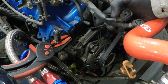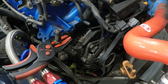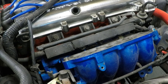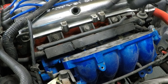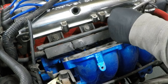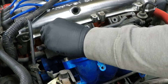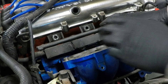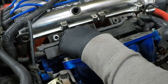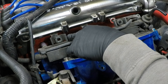Down the bottom here on the end of the wiring harness that runs through the fuel rail, there is a ground that goes straight to the alternator, so we'll take that off. For the fuel rail, that is just three bolts. Underneath all of these there are plastic little washers — you may lose them, so be careful. Just a little pry away. There are the plastic washers — don't lose them.